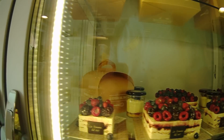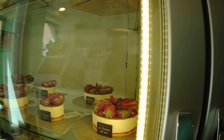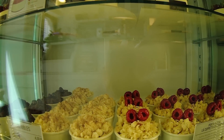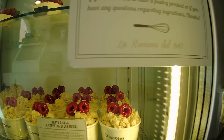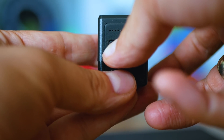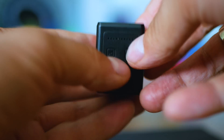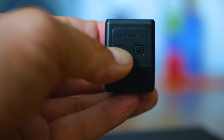There are three different modes: 1080p recording where the LED is blue, 2.5K where the LED is red, and photo mode where both the red and blue LEDs are on. Switching between these modes happens by pressing the mode button for more than 3 seconds and hearing a beep afterwards, so it's not that difficult.